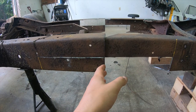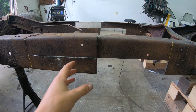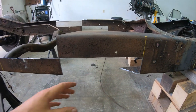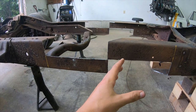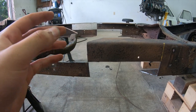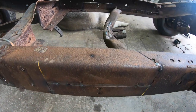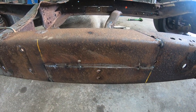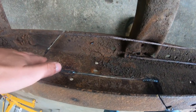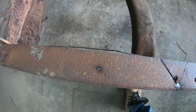The reason you want to leave 12 inches on either side of your center cut is to make a step joint. To make a step joint, you take out the top half of one side of the frame and the bottom half of the other, and they slide into each other. It's much stronger than just cutting down the middle and welding it back up — that's the right way to do it. I just slid both parts of the frame together so you can see what the joint is supposed to look like, and for added strength you should also bolt a plate inside.